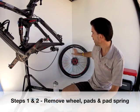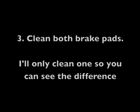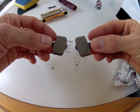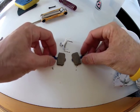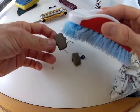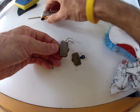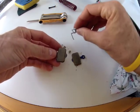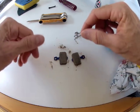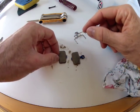I've actually done the first two steps already — I've removed my rear wheel and I've removed my rear disc brake pads and the pad spring. Now if you have a look closely, you'll see that the disc brake pads are just covered in mud with a layer of mud on the surface. So we're just going to give that a good clean. I'll scrub around the pad with the scrubbing brush and scrub on the back too, to make sure it's nice and flat and smooth where the piston pushes down on the brake pad. I'll use my screwdriver as well just to get around the edges to make sure all that mud's off and to make sure the pad spring has somewhere nice and flat to sit around the square edges of the pad. Then after that I'll give it a wipe, and if needed I'll use a bit of water to help remove that mud.